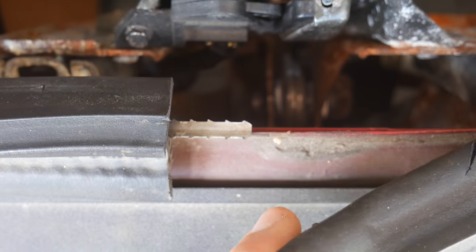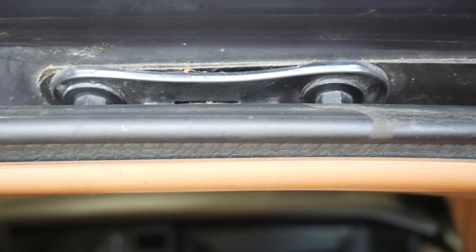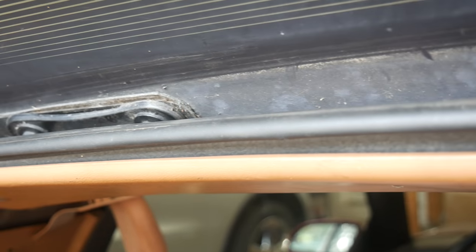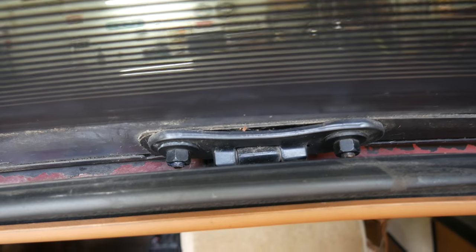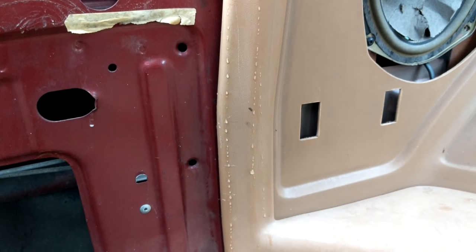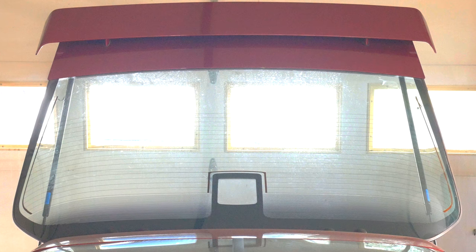For now, since the weather stripping at the top of the hatch appears to be in good shape and is making solid contact all the way across the glass, we'll take a look at the other obvious place water could be getting through in that area — and that is through the hatch hinges themselves. The hatch is attached to the body with two hinges and each is attached through the body with two studs. These bolt holes seem like a likely enough pathway for water into the car, so we'll have a go at resealing them. We decided the best way to do that and make sure the surfaces were clean was to fully remove the hatch from the vehicle.